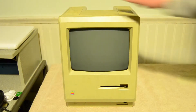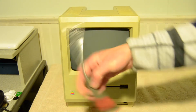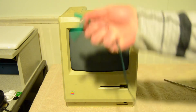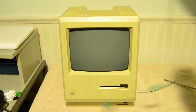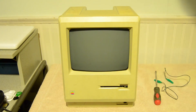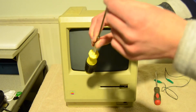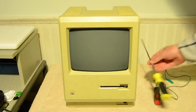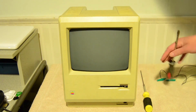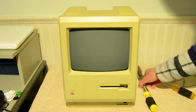To completely disassemble this thing you'll need an insulated flat-tipped screwdriver because there's a CRT you need to discharge. You'll also need insulated alligator clips - you only need one, though they come in a pack. And you'll need a special Mac cracker, which is just a really long security screwdriver. Just look up 'Mac cracker' on eBay and you'll find it, plus a regular screwdriver.